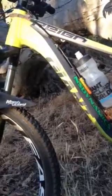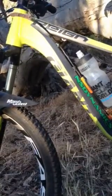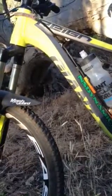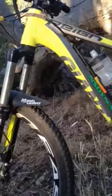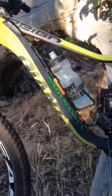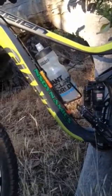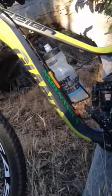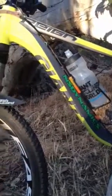Make sure, as you take air out, you want to click the rebound up a little bit, but keep in mind that a little bit of air won't make a lot of difference. A lot of air will. So just stay on top of that rebound stuff there. Compression, leave it almost all the way open to start with. You can fiddle with that once you get your sag and air pressures right.